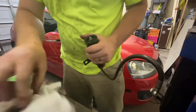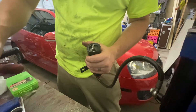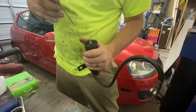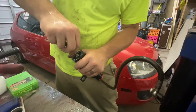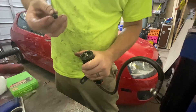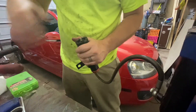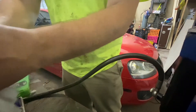Now if I can find my pick — you need to know how far down that piston is. I took measurements based on how this one originally was when I redid the other one. What I found is that we need to have that down pretty much a full pick-length. Push slowly, try not to damage it, and then once we put the other stuff back on, that should be about perfect.